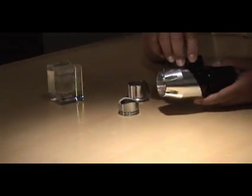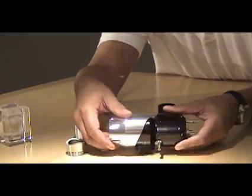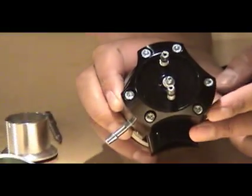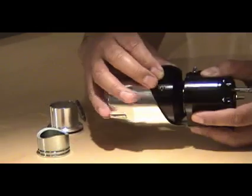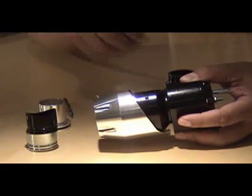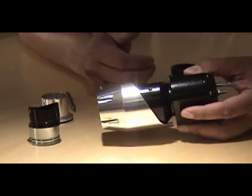The great thing about the weld-on fitting is it allows the blow-off valve to be used as it was designed. The weld-on fitting is very small and is meant to have the blow-off valve sit four millimeters above the intercooler pipe. The blow-off valve has a curvature on the back because it's meant to hug the intercooler pipe and sit very low. As for why there's no mild steel flange — with stainless steel you can use a different type of weld rod, either MIG or TIG, and securely weld that grade of stainless onto mild steel.